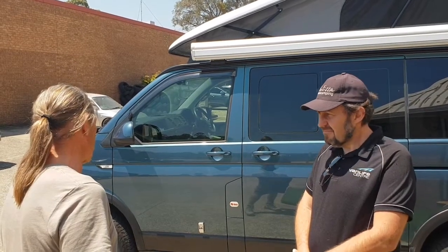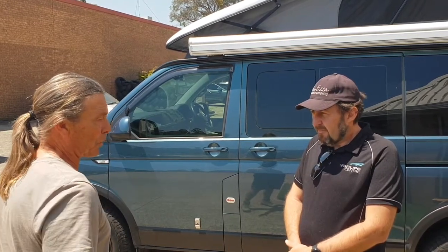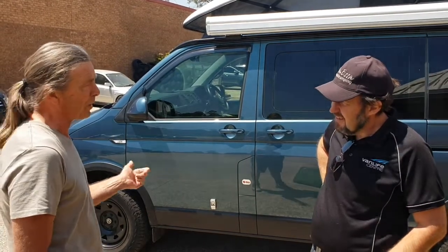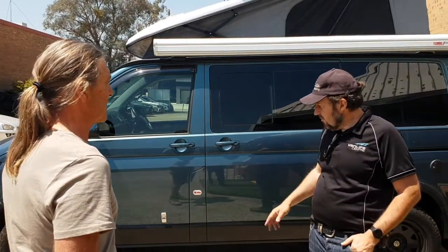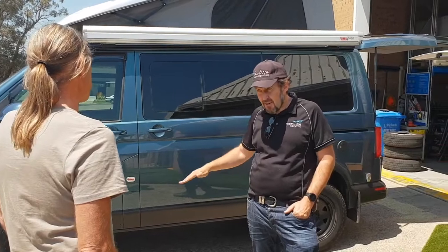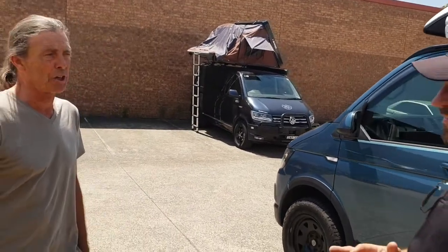The other point of view is that I can elevate the vehicle when I need the extra height, so I'm not overloading the CVs. You can elevate as required and put it back to a more regular ride height to not stress the CVs permanently. And also a four-corner adjustment process for camping — so we can do a bit of self-leveling rather than having to use leveling chocks. What's the ride height range? From standard to around about 90mm height.